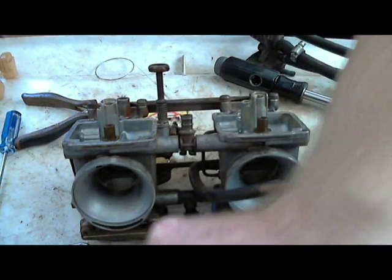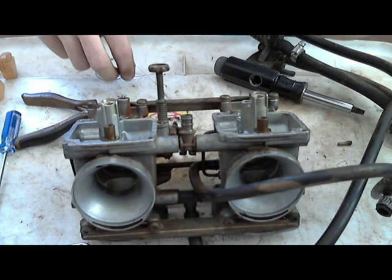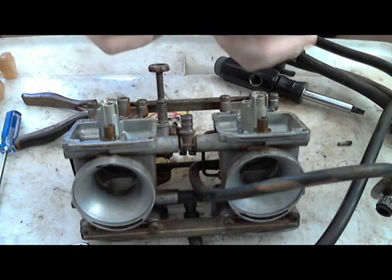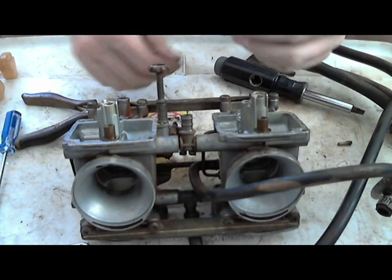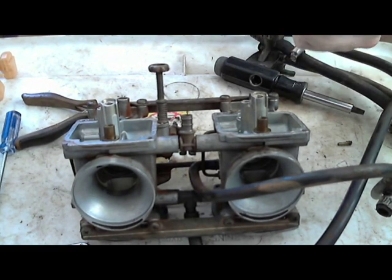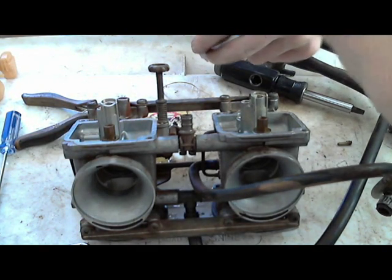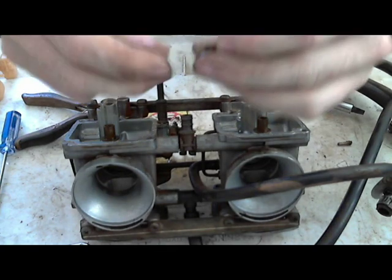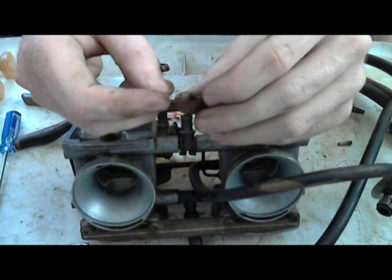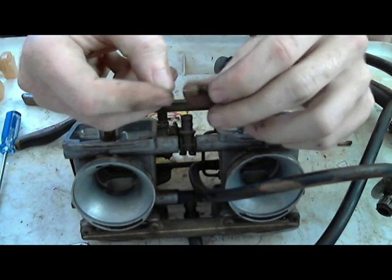And the needle jet, or the main jet, you don't really have to clean that much. I still use the guitar string. Of course, I'm going to spray it with air. Whenever you spray it with the carburetor cleaner and then stick the string through the jet, if you're pushing on it with the side of your thumb and you kind of roll it, you can think about what the string is doing